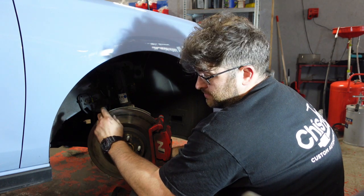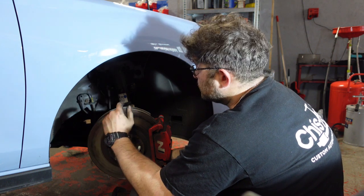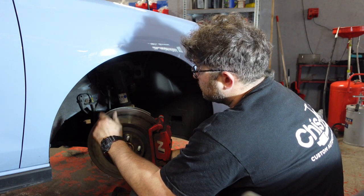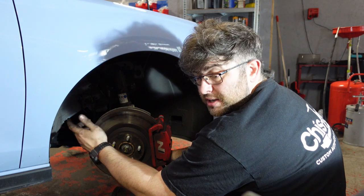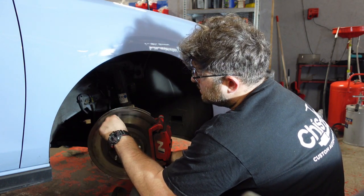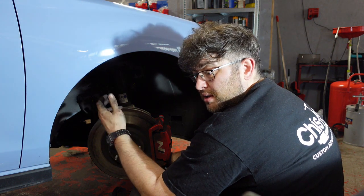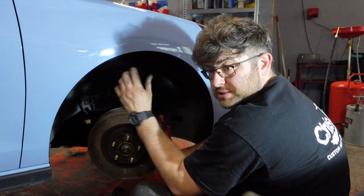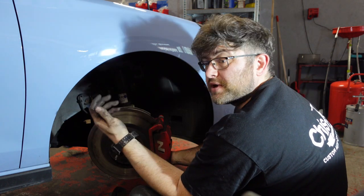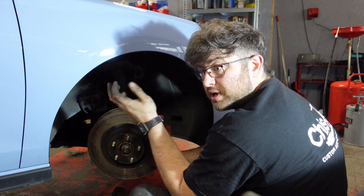which we thought was an issue with the steering column, because that can be an issue. And what happened was, I went into Hyundai, the guys had a look at it, serviced it, and they noticed one of the marks where the bolts had been marked with pen. They noticed it was slightly out, so they checked the torque figures and it was ever so slightly loose, and the click went away.